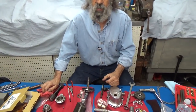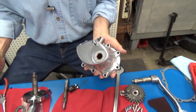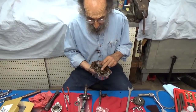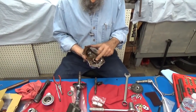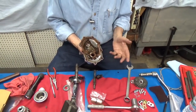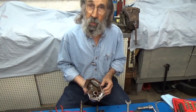Tonight we're going to put together this kickstarter. This is an old kickstarter cover — I think from the 1960s. I've had it on I don't know how many different machines; we have quite a history. It's been chromed, stripped, machined, and repaired. What happens with these covers, especially the earlier ones, is they crack in this boss here and you have to have them welded and machined to repair them, or you buy a new replacement cover. A good heli-arc artist who's also a machinist can do this.